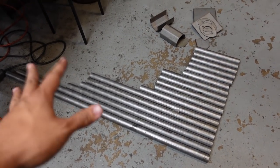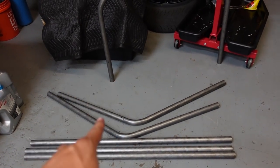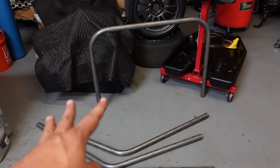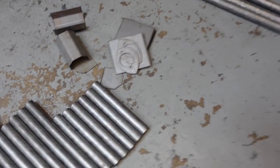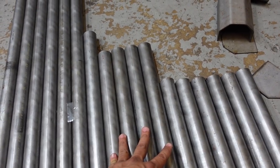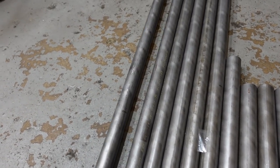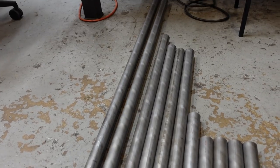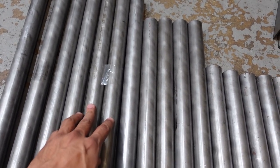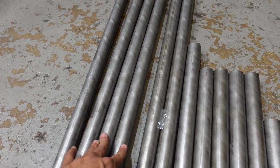Here is the rest of the tubes laid out by size — longest bars to shortest bars, and the door bars over there. I'm not going to use the front pillar bars or the front halo from the kit since those are going to be custom made. I have the door bars, the door bar ribs which are the six tubes here, and the intrusion bars. Then there's what I believe is the diagonal pipe, which is the longest dash bar, four pipes, two that should be the bars going to the rear strut towers, and two that are going to be the harness bars.